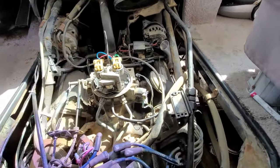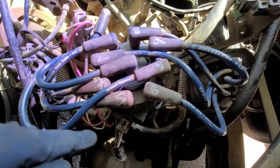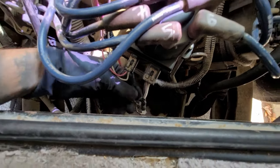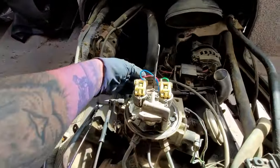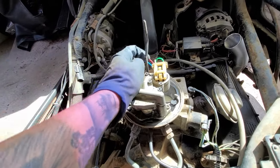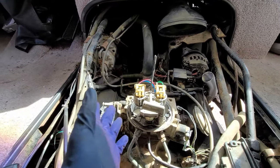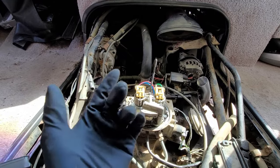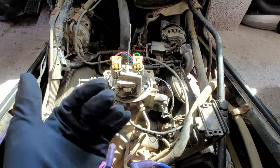For the purple wire, it's going to be 0.5 volts — with the key on you should read half a volt. The black-red wire is our ground wire that goes to the computer. The purple-white wire also goes to the computer — that's our signal reference wire that tells the computer to ground out the injector, because our red wire is always going to be 12 volts with the key on. The computer sends a ground signal like a relay. You kind of need a lab scope for that — it's harder with a multimeter — because with a lab scope you can see the faster response.